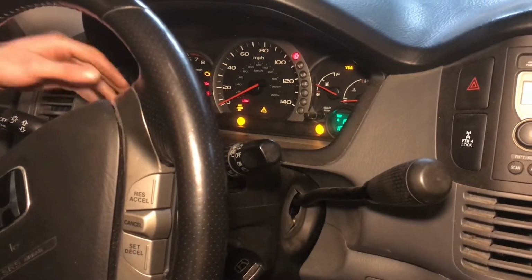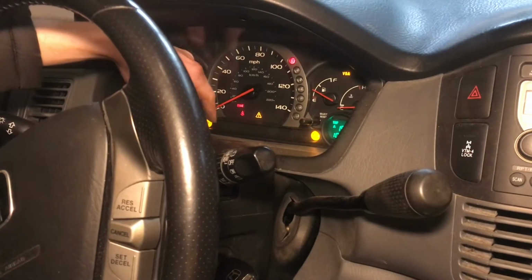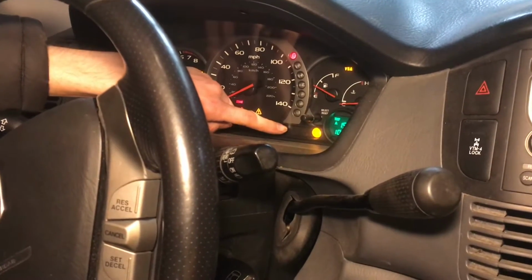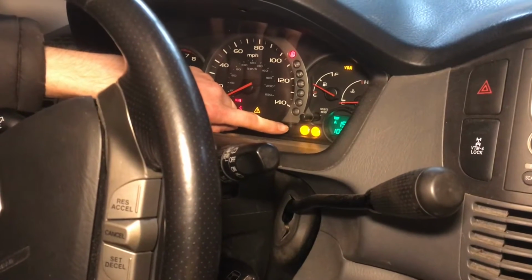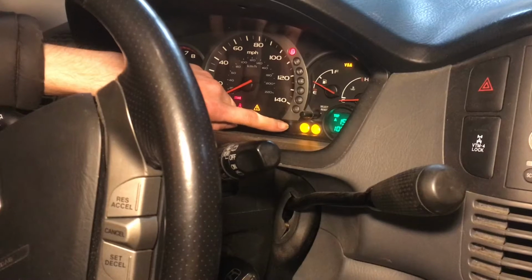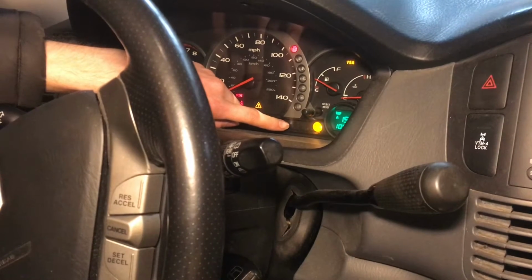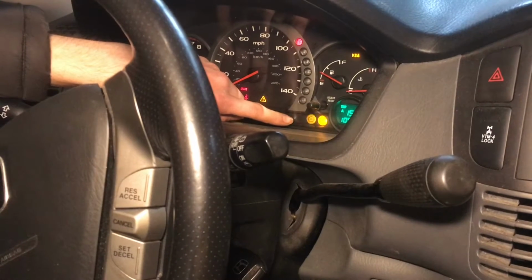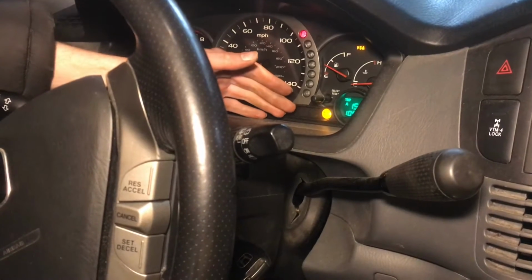At this point, the different systems would start flashing out error codes, and we're looking at the ABS. So just wait for the long, and then there'll be a couple shorts. There might be a couple longs and a couple shorts, and you just want to take note of how many longs and then how many shorts. So let's wait a second and count this out.